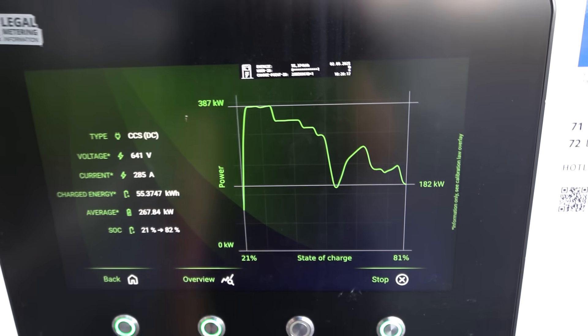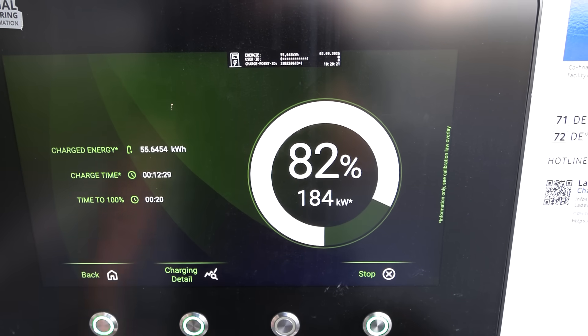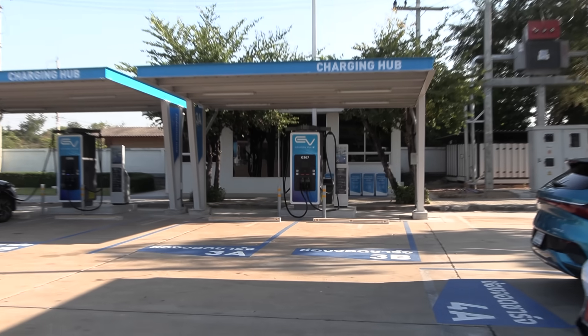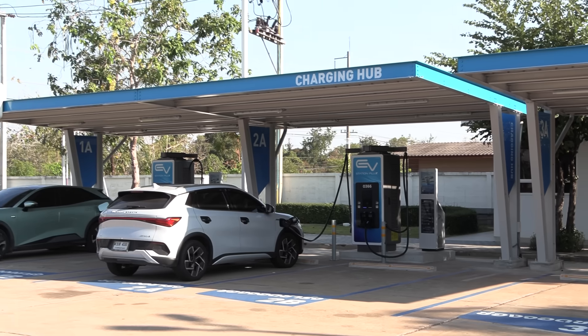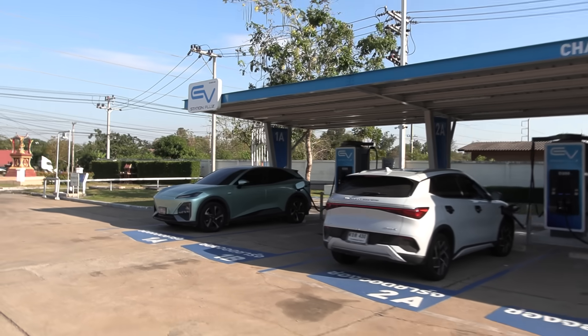In the daytime if it's 25 degrees Celsius outside and sunny, you might get the 500 or 600 amp boost for only five or six minutes. And if it's really hot outside - like Thailand or Spain hot - instead of getting 300 amp continuous, you might go as low as 265 amp. There's lots of electronics measuring things and trying to figure out what's possible at that given situation.